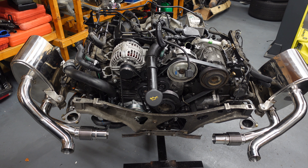I've put a lot of money into this car and this engine. Many people say you've got to be successful to own a Porsche and rebuild one the way I've done it. I've had many people message me asking if I can rebuild their 997 — but when I tell them everything that needs replacing as it comes off, they don't want to know. They only want the bore score repaired. You physically can't do just that on these cars. Things rust, things corrode due to heat. You've got CCV pipes that become brittle and snap — that's £600 alone. People don't think it through; they think you can just fix the bore score and put it all back together.